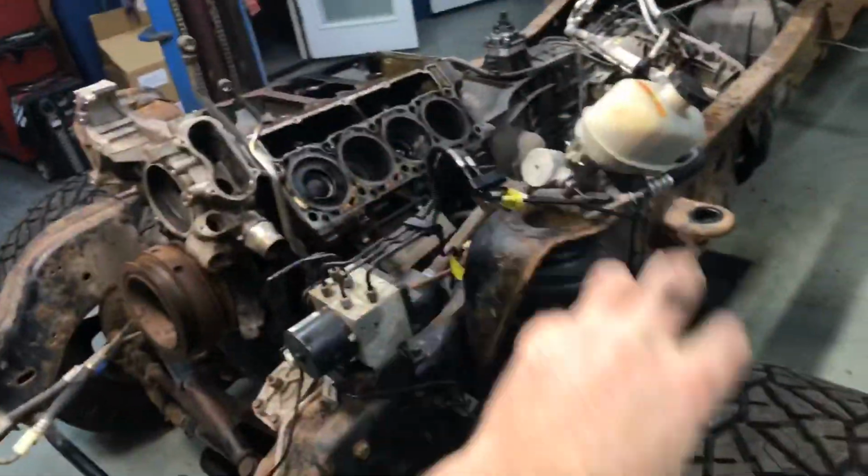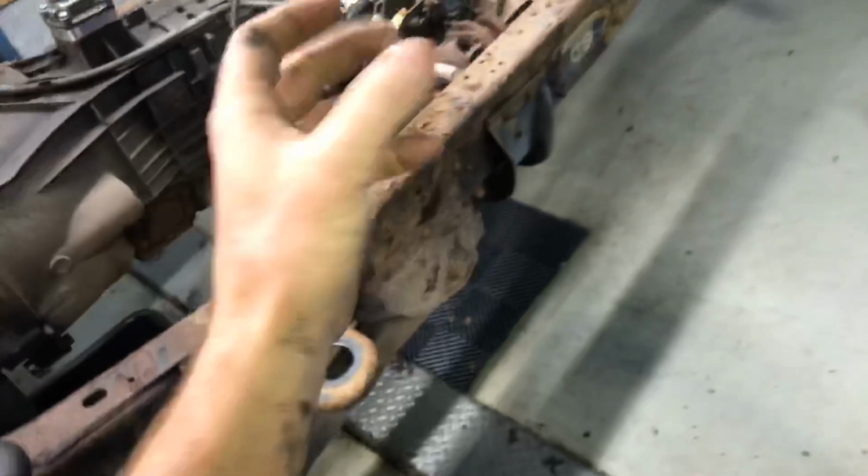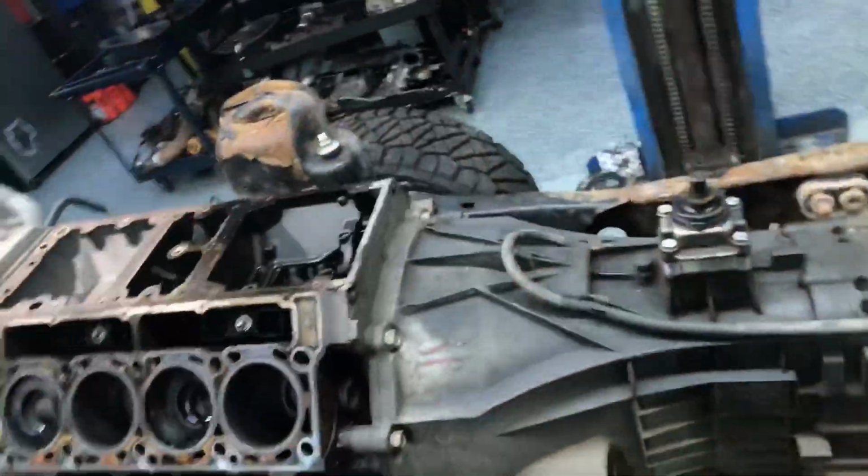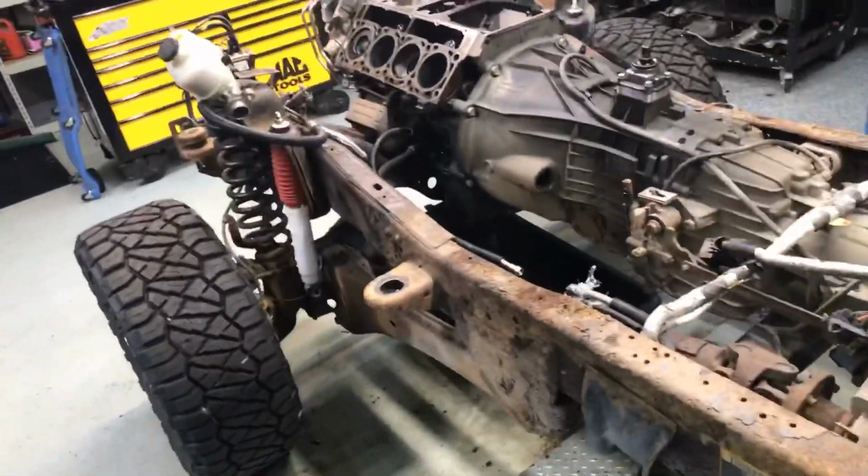I mean, I don't believe in the hype, because the clutch disc itself, the ones with the buttons on them, they have like Kevlar on one side and ceramic on the other. I tried those. South Bend does make a clutch though that is an OEM replacement style that has the entire media around, like brake pad style all the way around, not just those little buttons. The entire surface area, I liked that a lot. South Bend did have one of them.